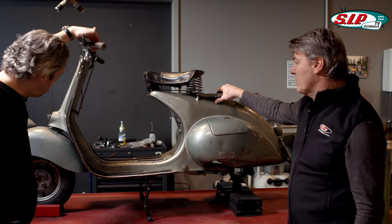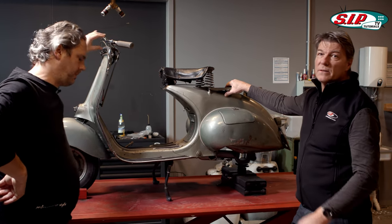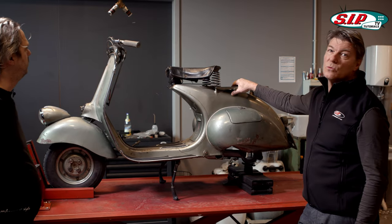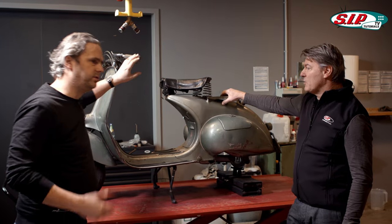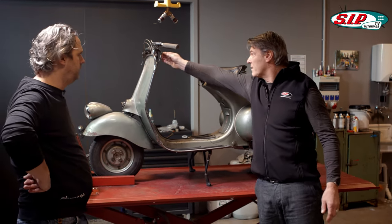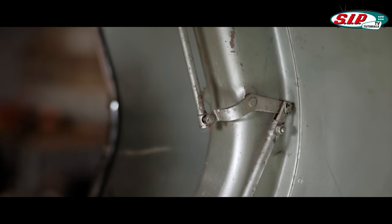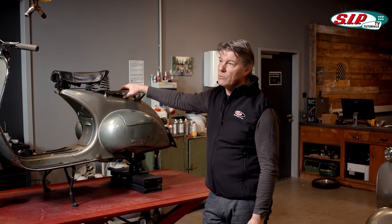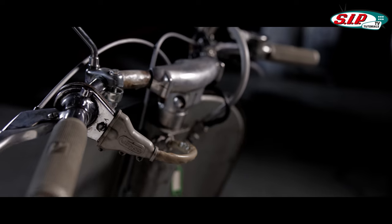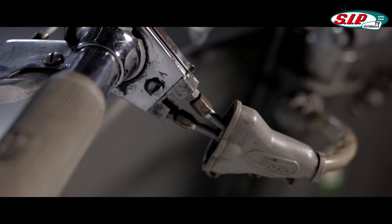The new series was the V30, which had already made the change to a cable gear shift. Why was it changed? Over time it was clear that the rod system was relatively fragile when operated for years — the adjustment got knocked out over time, meaning gears could no longer be shifted properly. That's why they switched to the more comfortable cable gear shift. On the V31 you can see the cables go into the frame, but the gear shifter with cables is still outside.